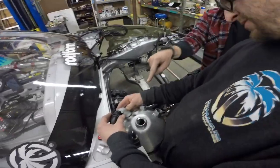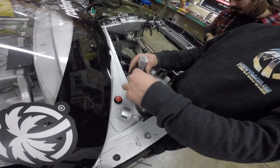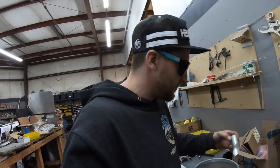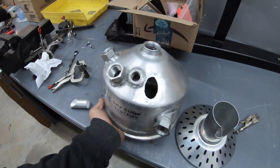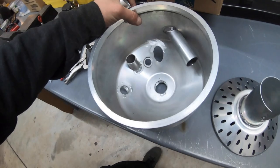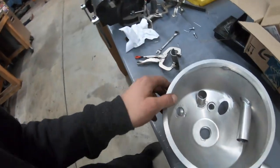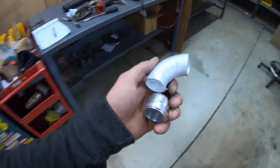Yeah, okay, you're trying to shoot that gap — I see. I think it'll be good; I need to open this up anyway. This is my new inner baffle piece. I cut it off here and this piece goes inside of the catch can — or inside of the oil tank here — and it sits in this baffle. It really helps keep the oil out of the port that's going to be running back to the catch can, and then I have my fittings here for the top.